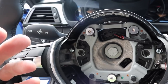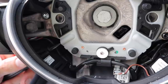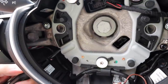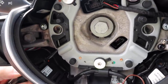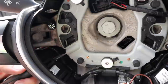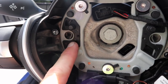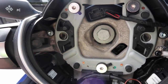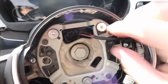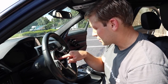If it's your first time doing this, it's a lot easier said than done. Stick the screwdriver into that hole straight in — there's a release spring inside, and that's really what you're aiming for. Sometimes people hit the metal and get frustrated, but what you're doing is pressing in a small piece of metal inside the circle to release the airbag. Do the same on the other side. While you're here, connect that other connection. Also connect any remaining harness connections.